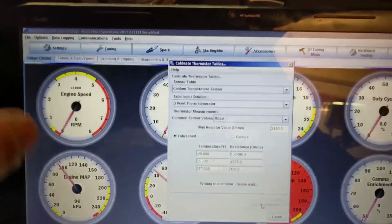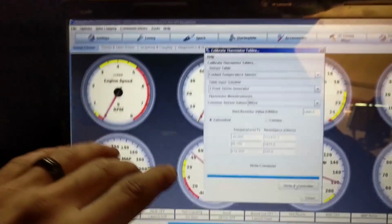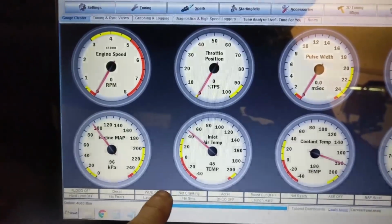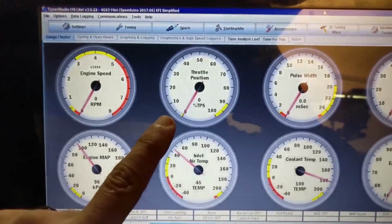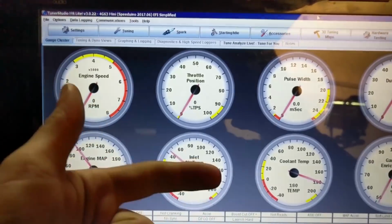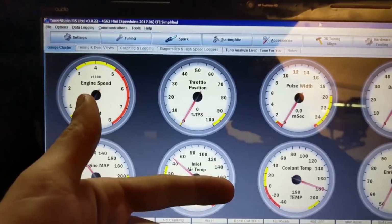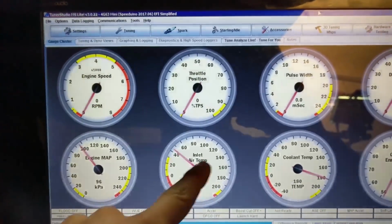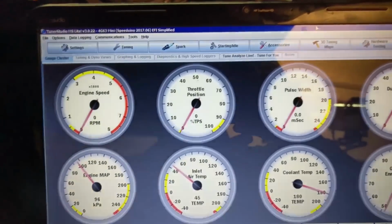Excuse me. And thank you to everyone that said bless you to the screen. We're going to see if we can figure out what's going on with the throttle position sensor. I did damage the ECU a bit, so I'm going to have to either fix that or get a new one, because I ripped a wire out and it shredded the board, which sucks. But throttle position is still not registering, at least with the wires hooked up. That could be a voltage issue, or a TPS issue, but I think that should be fine because I tested it before and it was working on the other car. It could be that it's not configured properly in the table, similar to how this one was. So we're just going to dig around and see what we can figure out.